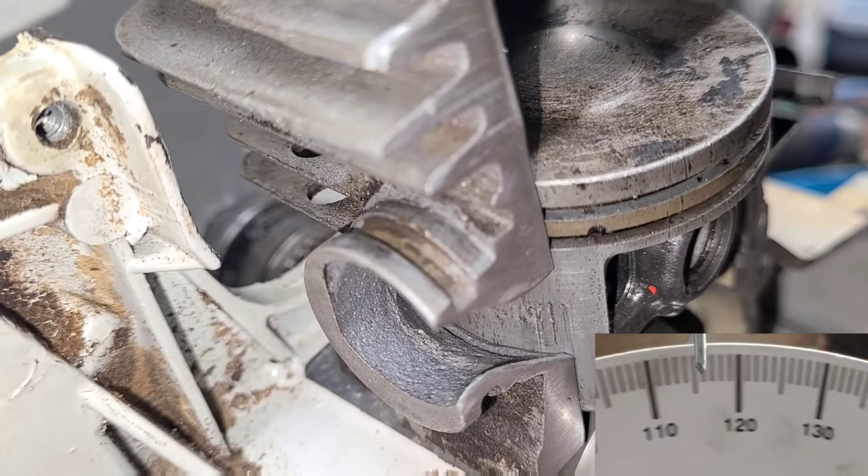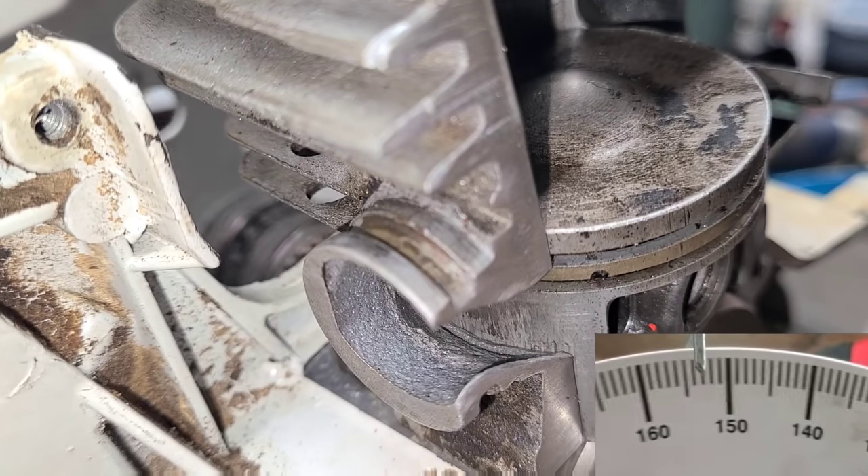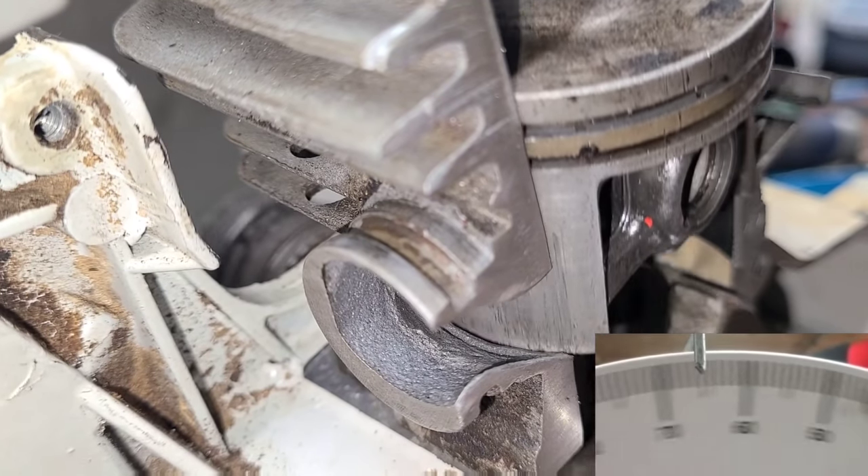Now, your intake timing is when your piston opens the intake port. The piston skirt clears the intake port at 73 degrees before top dead center. For duration, spin it around until it closes — same thing. You can recreate this measurement both ways, and that's how you know your wheel is zeroed.